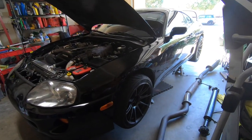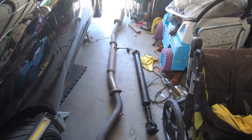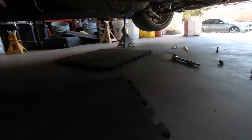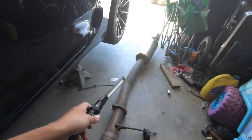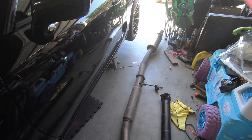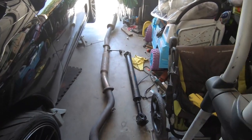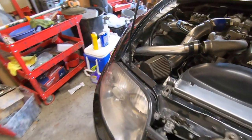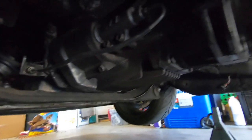We're on day two of taking out the transmission. I've got the drive shaft and exhaust off. Another thing I did was take out the transmission brace — or at least loosen it — which is being held by a jack right there. I had time-lapses of those steps but had the settings wrong and they came out way too fast, only a two-second clip. Still need to take out the clutch slave and loosen up the transmission.